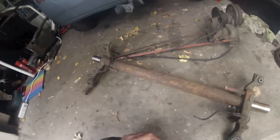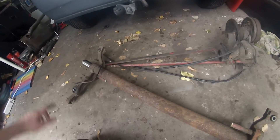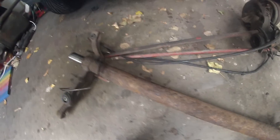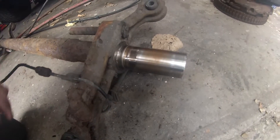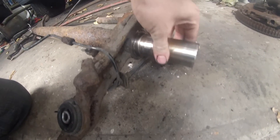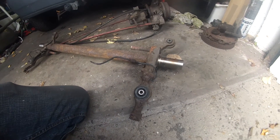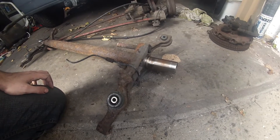This is the rear axle — I took this one apart to check if the center tube was still usable. How it works: this is the center tube, and on both ends there are bearing surfaces with swing arms with roller bearings in them, and the torsion bar acts as a spring. This one looks fine; however, this one has a pretty deep imprint of rollers in it — it's not smooth at all, it's a very wavy surface. That pretty much means it's ruined, since pressing in a new one is more expensive than a complete rear axle. This is a very common problem with these rear axles — that's why I rebuilt the axle on the track car, as it had the same thing on both sides.